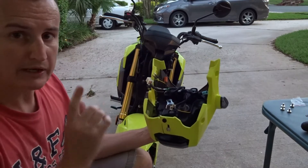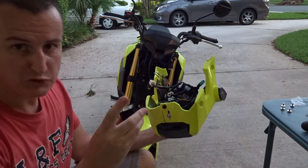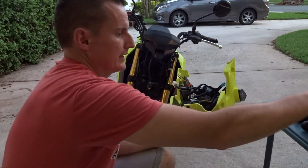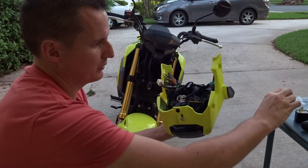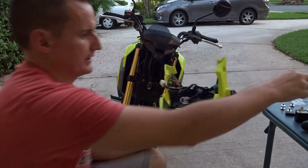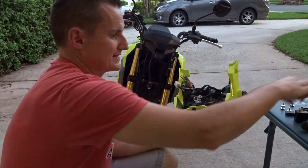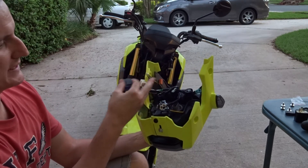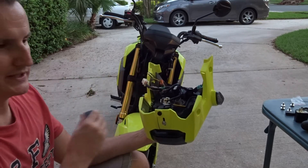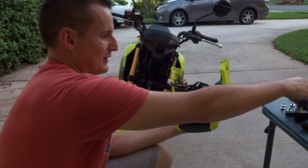I've already put it back together as you can see. Now we're doing the wiring side. I took the original old flasher relay off — what you need to do is salvage two pieces from it: the actual rubber clip that holds it on, and the cover. Pull the cover off the old one so you can reuse it on your new relay that works for LEDs. Slide the clip right back on, put the cover on, plug it in, then use the adapters to plug into the harness, tie it back, and you're done. Literally a 10-minute job.